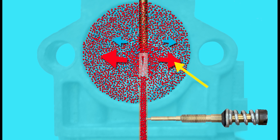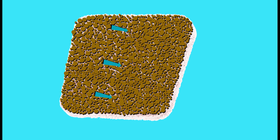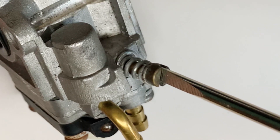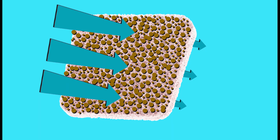So in this situation we would screw in the screw slowly, reducing the amount of fuel coming out of the main jet to make the ratio of air and fuel much better for the engine again. Of course if the filter is too blocked then it needs to be changed. What I'm trying to say is that we can make adjustments to the carburetor when the air filter starts to accumulate debris and try to get the engine running as best as we can under those conditions.